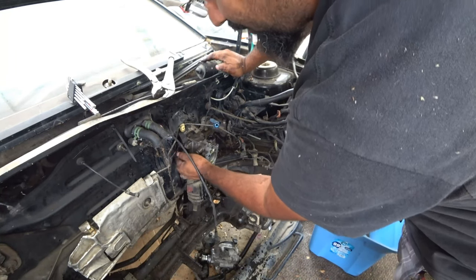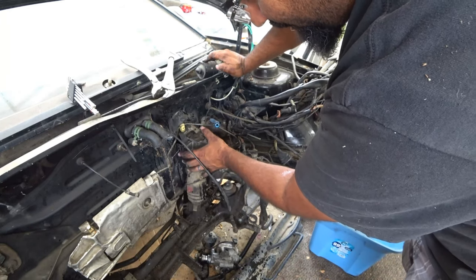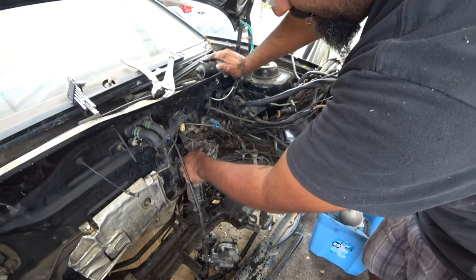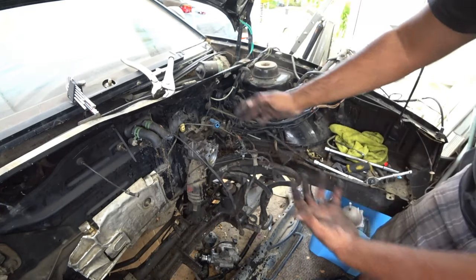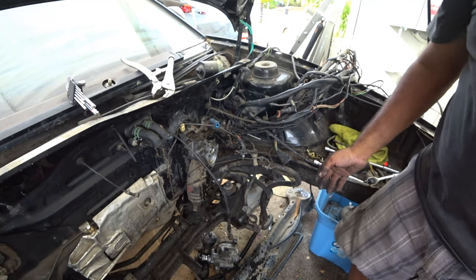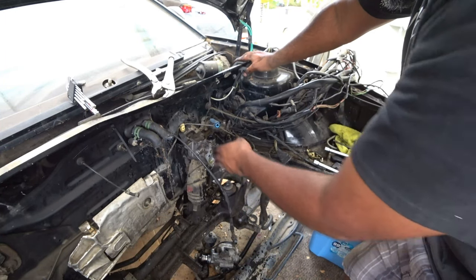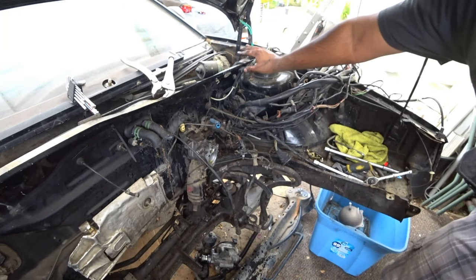So these come out through the back. They're bolted through, installed in reverse. So what you have to do to get this whole assembly out is take out the 4 bolts underneath the dash, and this will let you pull this whole assembly out. Which we're going to have to do because we're getting a new brake system, so we cannot use this assembly. We're going to have to hunt down a Mark III with a bracket and everything so we can mount that brake setup.